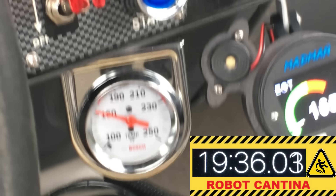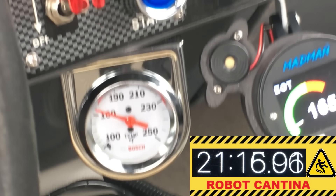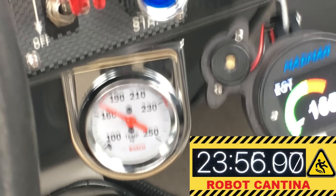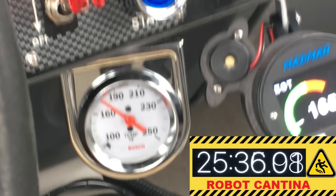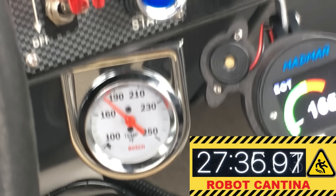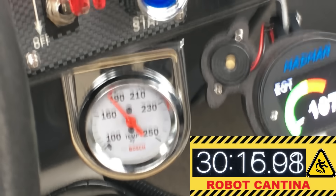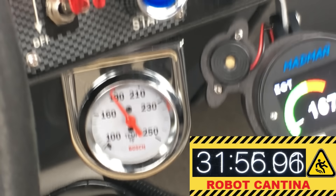There are several reasons why it's taking so long. First, it's cold outside. Second, the engine is just idling and this tiny engine doesn't consume much fuel at idle, so as a result it doesn't get very hot. Thirdly, the bypass hole in the thermostat is allowing some of the hot coolant to flow through the radiator. Now, some of you may be wondering about the purpose of the bypass hole — it's to allow bubbles to escape if air were to get into the cooling system. Without the bypass hole it takes forever to burp all the air from the cooling system, but it can be done, so it's safe to eliminate the hole for now. I've also read that the bypass hole allows the engine to warm up faster.